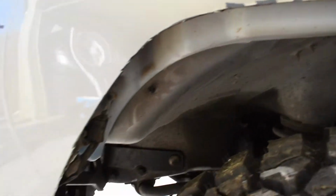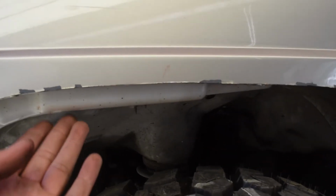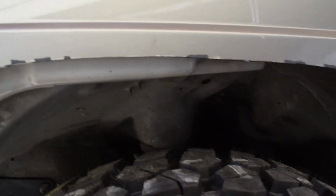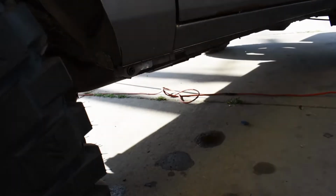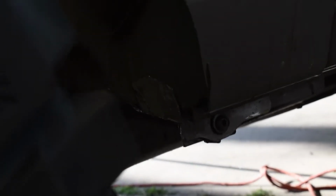All right, peeps. Well, I'm done. At least done for the day, because this thing still needs a lot of work, and it's just the front. So it's getting kind of difficult, but we'll see what happens. So let me show you guys what I mean. So again, I cut it off with the washer fluid back on. It's barely peeking, but I hammered in all these inner things, and then I cut the pinch weld on the side here, so now the tire doesn't hit that.